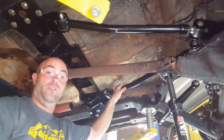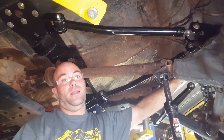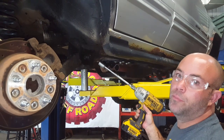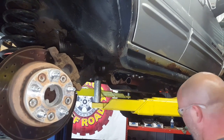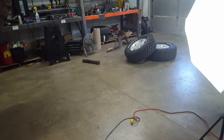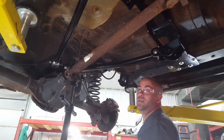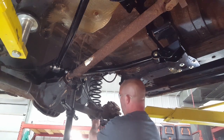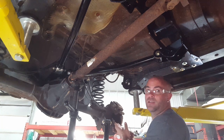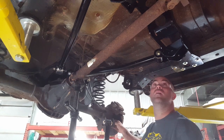We've installed our upper control arms. They go in with the bend facing down to clear the floor, and the adjustable male end is at the axle side. Next, we're going to pull out our lower control arms and put the new ones in. The lower control arms use two steel spacer washers to push the lower control arm in towards the center of the Jeep. Always put the rubber bushing side in first — it's easier to line up. The flex end can be maneuvered to ensure it's aligned before sliding it into the bracket.